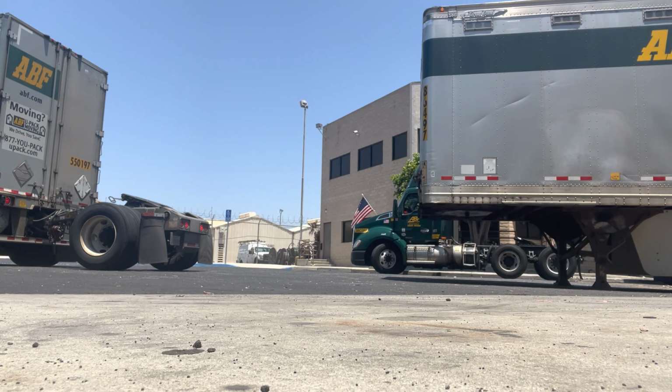So what I was doing there is basically just angling my drag trailer to be slightly offset, because I don't know if you can see, but my gear is a little bit more to the right than the rest of my lead trailer, right? See how it's off just a little bit? So it's gonna swing to my passenger side a little. So I angled this a little bit more to the right so that I can back up mostly straight and then follow it after, you know?